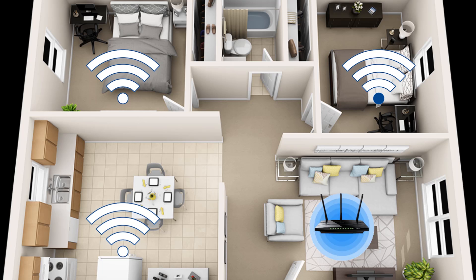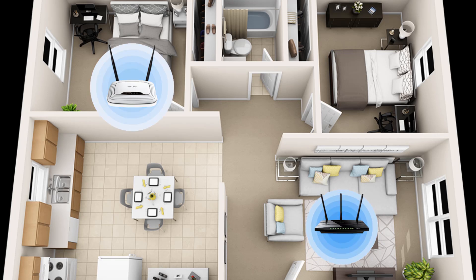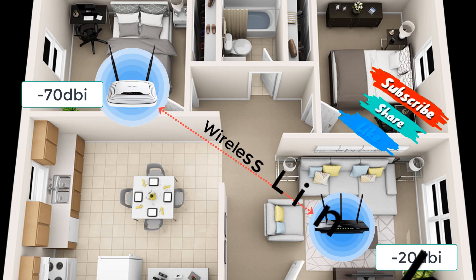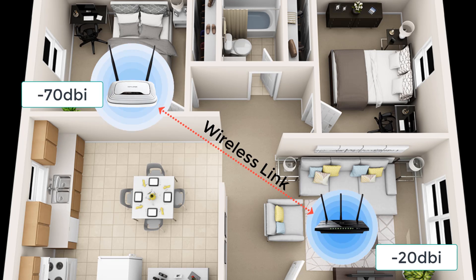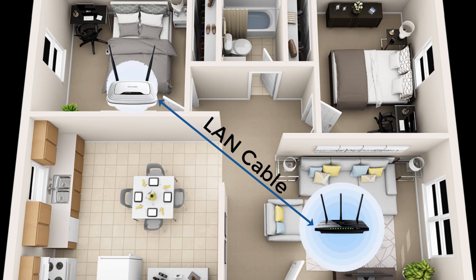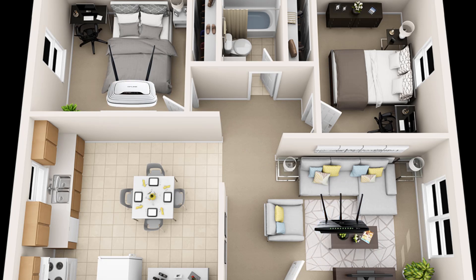So how to overcome this problem to get strong Wi-Fi signal in every corner of the house? In a previous video I showed how to connect two routers wirelessly without using cable — that works quite well. But because of so many Wi-Fi signals in my neighborhood, my home became Wi-Fi crowded, and many walls block my signal. The wireless link between the main router and extender router is poor, so devices connected to the extender face speed issues. To overcome this, I decided to connect two routers using a wired Ethernet or LAN cable, so the link will not be affected by walls, household appliances, or nearby Wi-Fi signals.